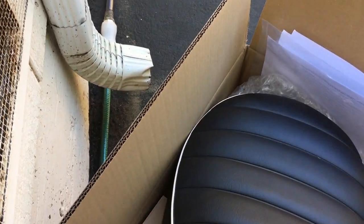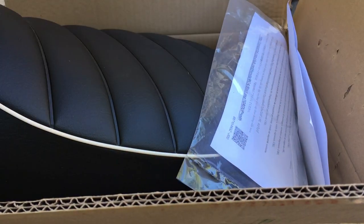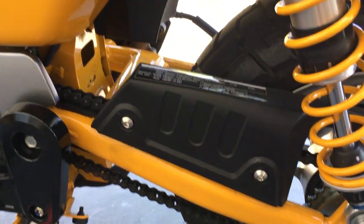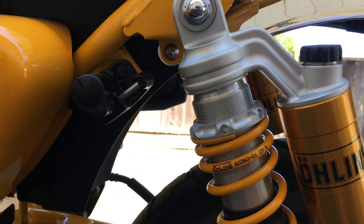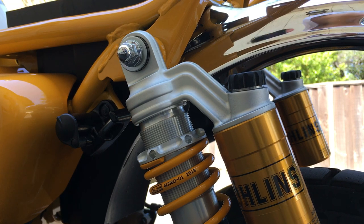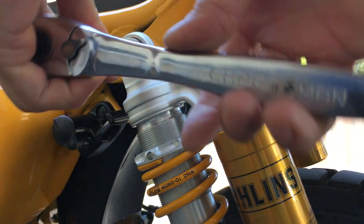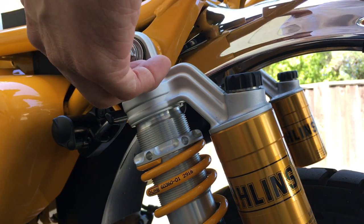Let me take the seat and put it somewhere where it doesn't get banged up - put it back in the box. Let me grab my rack. I should loosen up the bolts here on the shocks. Those ones are 14 millimeters. I got my 14. This thing is torqued to - the service manual says torque at 21 foot-pounds. That's the torque setting, and that's one side and the other side as well.